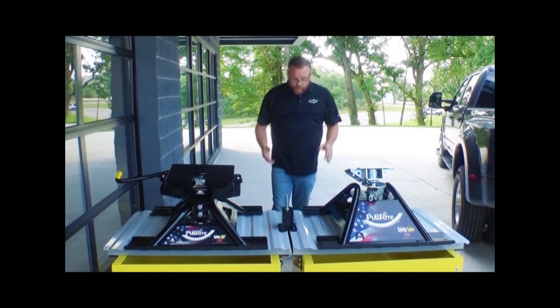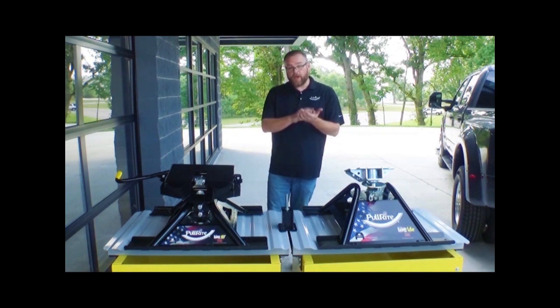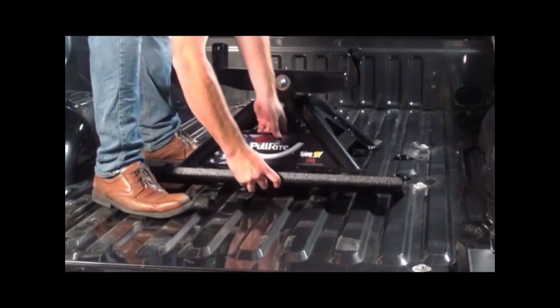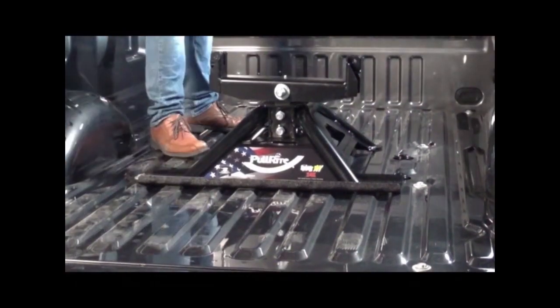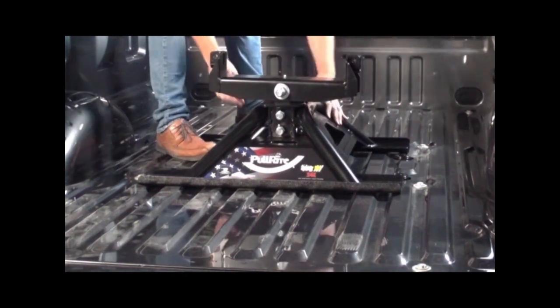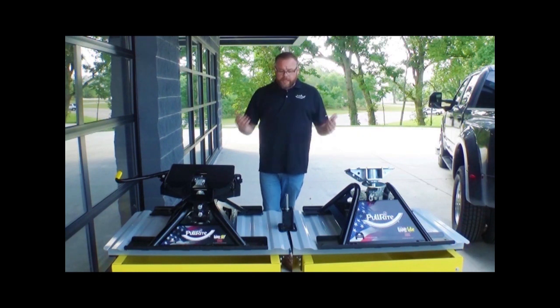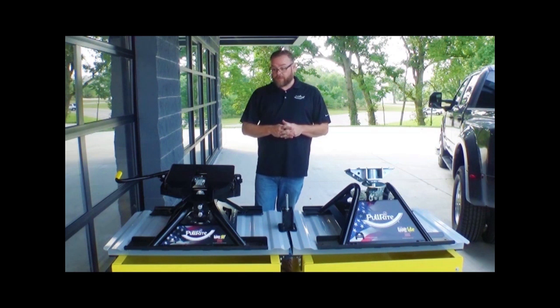Now another similarity between these two products are these bed savers right here. You can see those on the bed of the truck — they go between the hitch and the bed of the truck, and they're coated with a bed liner type material, so when these hitches are installed and sitting against the sheet metal of your new truck bed, you're not going to damage or abrase the truck bed. In addition, with single point towing off of a gooseneck ball, there's a lot of fore-to-aft pressure as you're accelerating and braking, and these bed savers do a very effective job of spreading that load out across the bed so you don't deform the bed of your truck. When talking single point towing, these two products are very economical, extremely lightweight at 64 and 74 pounds, so they're easy enough for one person to get in and out, and they install very easily providing an exceptional towing platform for your OE puck system truck.